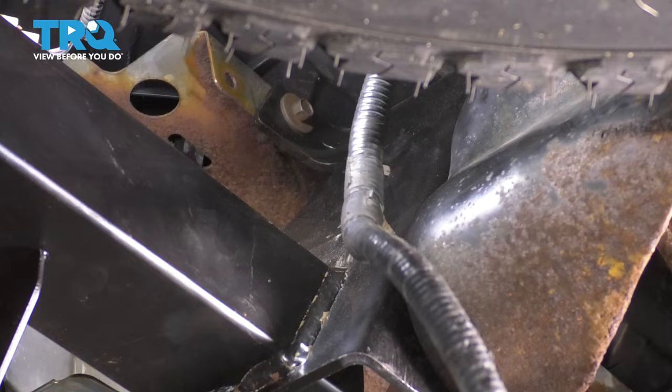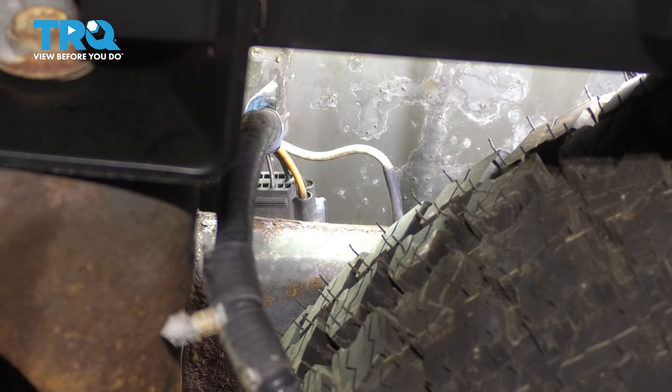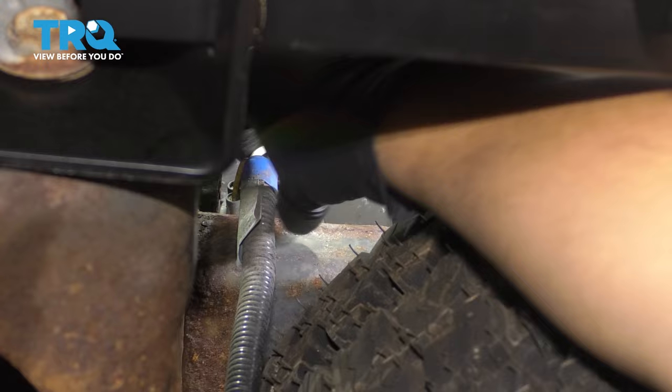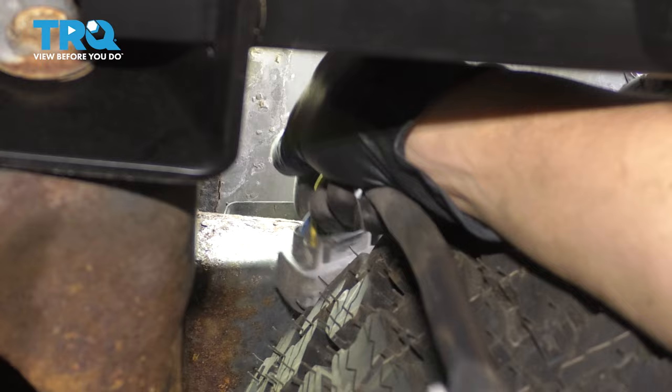Following the harness up, you can see where it connects to the main harness that goes into the vehicle. That white wire on the right side is a ground, and there's a 10-millimeter bolt going through it. The other one, the main connector, is just clipped on there. If you want, at this point you can lower your spare tire and get more access, but if you can reach it like this, just go ahead. I'm going to take this main harness out first — reach up for the locking tab on the top, press it, wiggle it off. Now all we have to do is remove that ground strap.